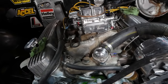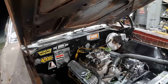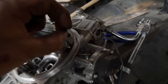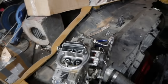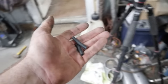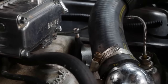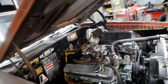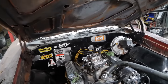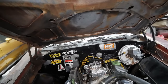This thing is blow-by city, so I'm actually going to hook up the PCV valve since this carb has a front port for it. Other than that I've got to plug one vacuum line and I think we're done. That vacuum cap tore right off — it had a cut in it the whole time. I'll shove a couple of screws and chunks of hose in there. The PCV is worth hooking up because it puts a vacuum on the crankcase and helps your piston ring seal — and keeps vapors out of the ozone.